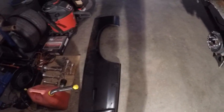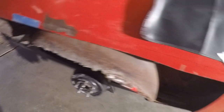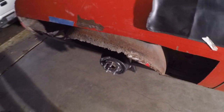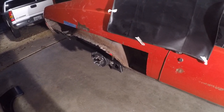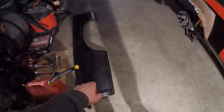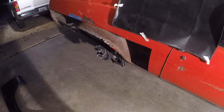This is where I'm going to stop for tonight. Here's my new panel ready for tomorrow - I've got to cut a little bit more to my line, then hopefully that'll fit nice and snug. That patch panel is painted and drying right now. I'm probably going to attack the wheelhouse tomorrow because that'll be done, and hopefully start welding. I do need to go get body sealer in the morning, seal up all the edges, patch all the little holes, and make sure all this is painted real nice before the quarter panel goes on - because likely that'll never be seen again. See you guys tomorrow.